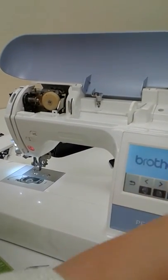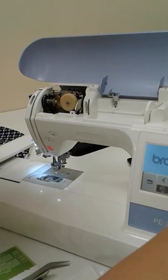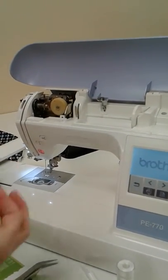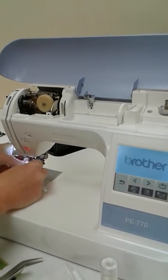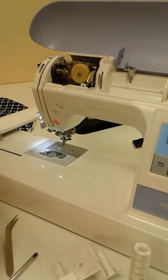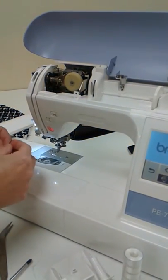You can turn the flywheel and it goes up and down just fine. Now, when I'm turning the flywheel — you may not hear this on the video — but I'm hearing a clicking noise. So I'm going to go ahead and change out the needle too. I like to use a nickel for that, because it loosens that screw just perfectly. Take the old needle out and we're going to put a new needle in. A lot of people ask me how often do you change the needle — if I'm having problems with breaking thread, that's the first thing I do is change the needle.